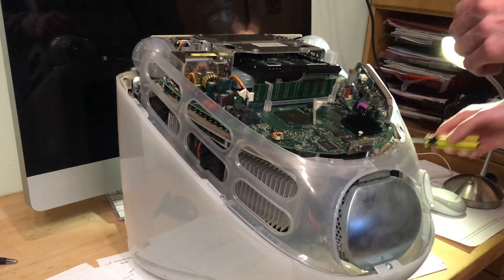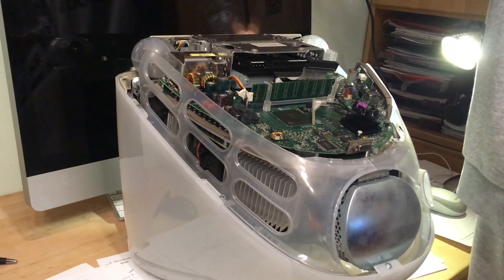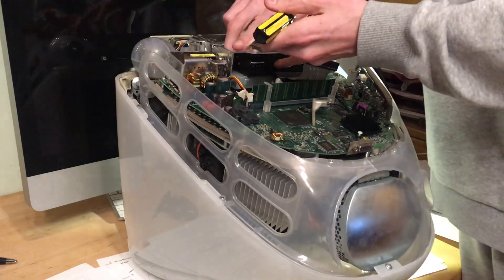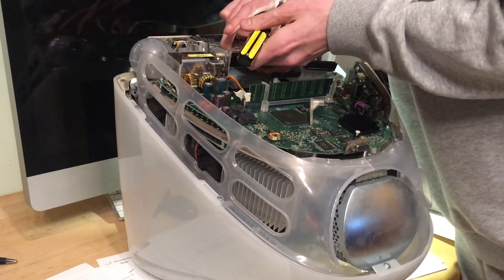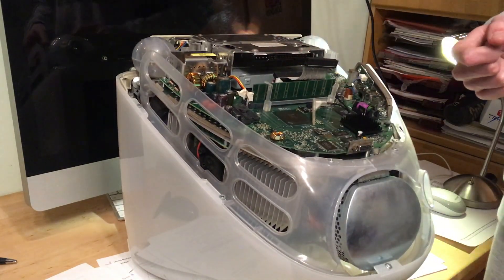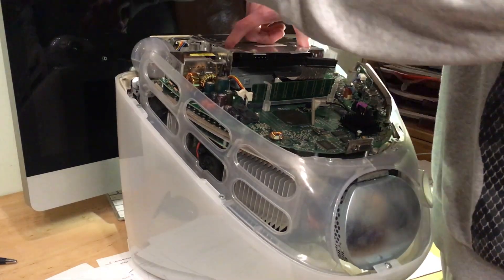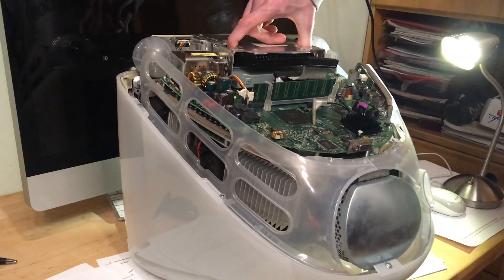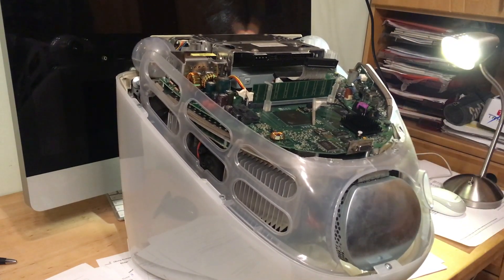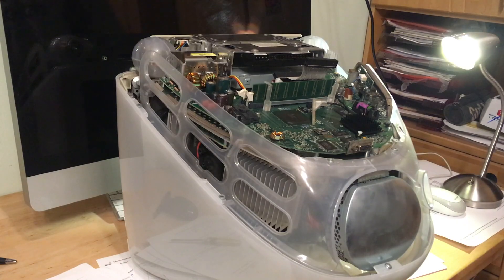You will actually need to hold this while reinserting it. I usually had a friend helping me on this step — I think this is the first time I've ever done it alone. You'll need to line up and align the holes. Be very careful tightening these screws — they strip incredibly easily. Just be careful, and if it's not 100% tight, don't worry, because when you flip it over to its normal position it's going to lay in there nicely anyway.